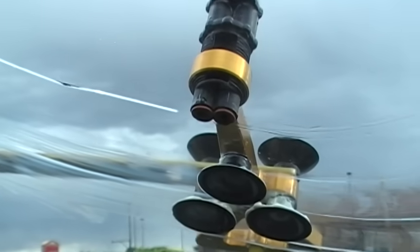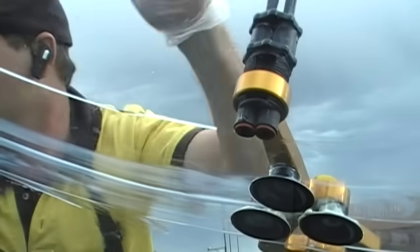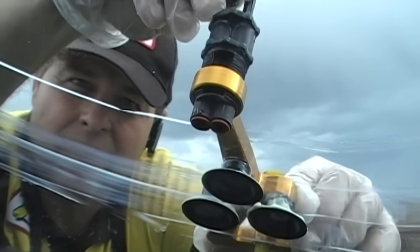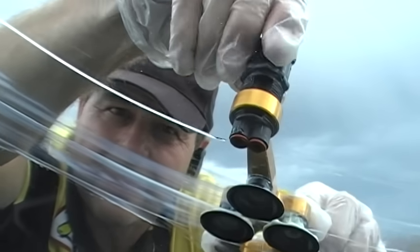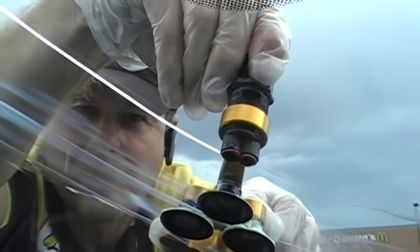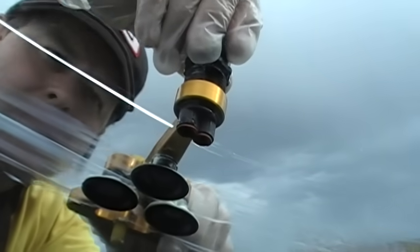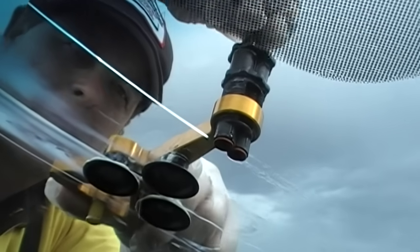You can see that clear gap in front of the tool — that's where the resin has already started to pre-fill. And again, this is zoomed up quite a bit, so this crack may look big on your screen. This tool is changing the viscosity of that resin by using both injector heads as it goes up the crack, so you get a nice, even blend all the way through. If it's doing that, you're going to get a nice, good-looking repair.